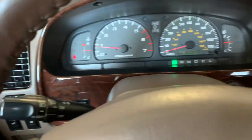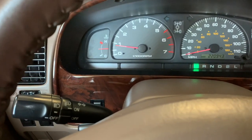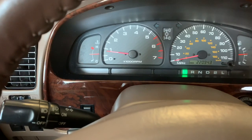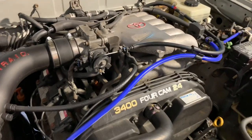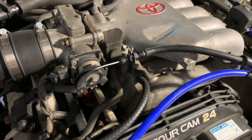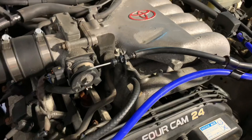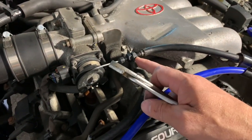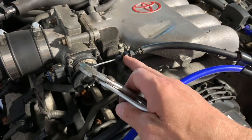As soon as you hit the AC, that's going to compensate if it's functioning correctly, and the RPM is going to jump up just a little bit to accommodate the added stress on the engine. I stress that you be careful with this, because this bolt has been known to break through years of use. Put a pair of pliers on it very lightly — you don't want to hold it too far — but see if that nut will move. Move it forward just a little bit to give more tension on the throttle cable, then tighten down your lock nut.